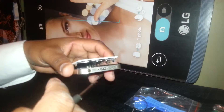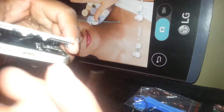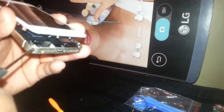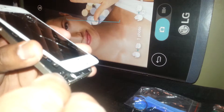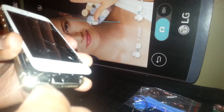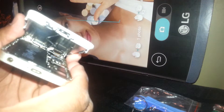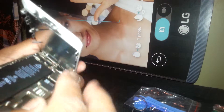On the CDMA 5s — from Sprint and Verizon — you will find this flex cable, but not on the GSM series. Using the flat-end screwdriver, insert it inside and lift or remove the flex cable from the bottom of the battery. Once that flex cable is removed, just lift at this point — but don't lift too much.